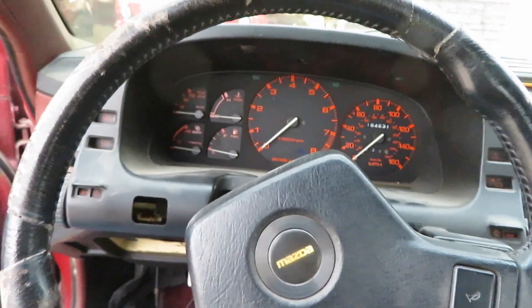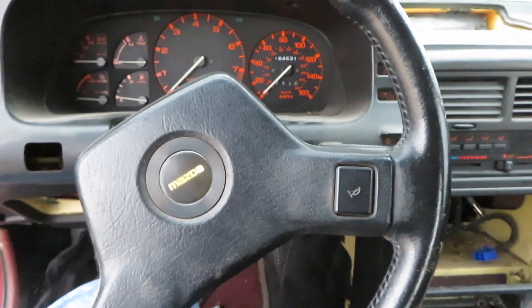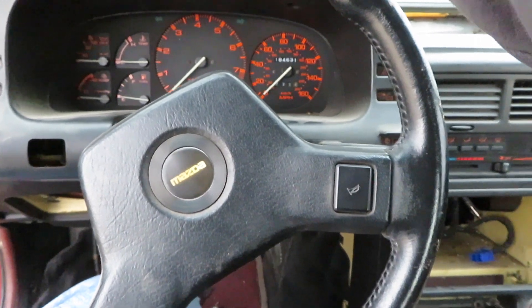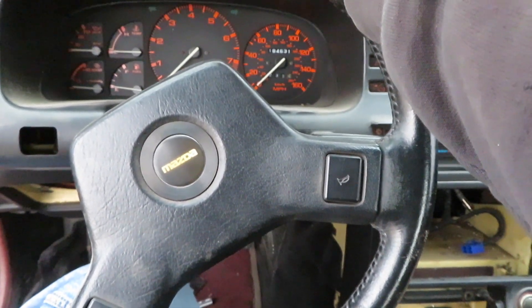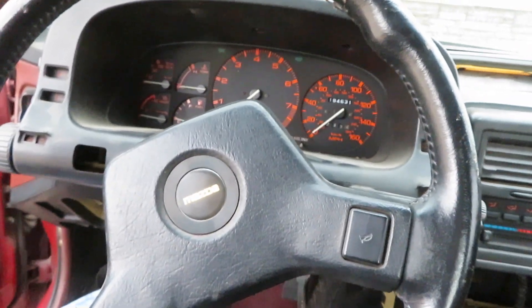What I was checking was power going from the block or the alternator over to this fuse panel, and for some reason it seems like I'm not getting any power. I need to get a volt meter over here to check this out. I think I was overreacting a little bit. I got a volt meter and checked all the power wires — I just didn't have the inside lug tight, so it wasn't making contact. Now we're 100% good to go.